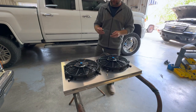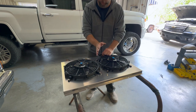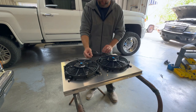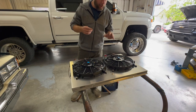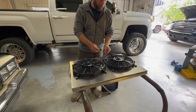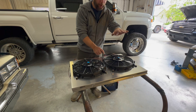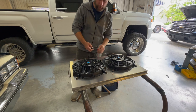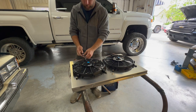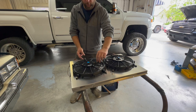All right, so we're really going to class this thing up. We've got a couple of wire clamps here — just going to kind of fit everything together. The controller is going to be on the passenger side, so we'll run everything over that way. One thing I'd recommend doing before putting all your wiring and situating how you want it: check how the fans blow based on the wire color. I just have a boost box with a couple of wire leads. That one does what we want based on the colors. If I didn't check this, it would be backwards — so better to check it now than later. Same with that one. We're good to go.